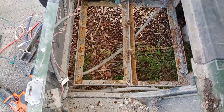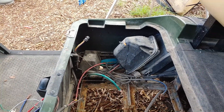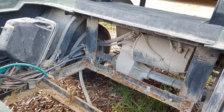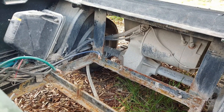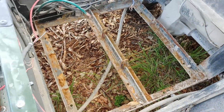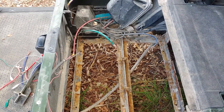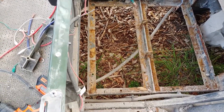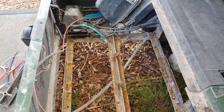Alright, we've got the batteries out. You can see it's pretty dirty — it's what you get living on a dirt road. Got the motor and the speed controller in tow mode, so it's turned off. Here we can see the motor back there. Honestly looks like it's in fair shape other than being dirty. When I brought the batteries over here, they were just not wide enough to fit in this tray. The old lead acids were ten and a half inches and these are closer to seven.